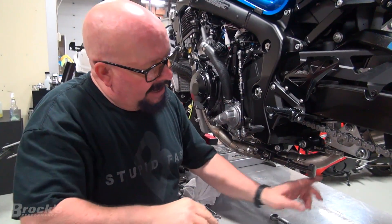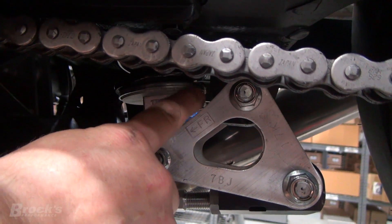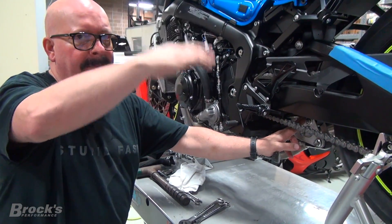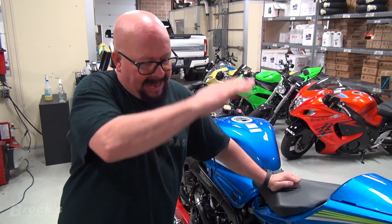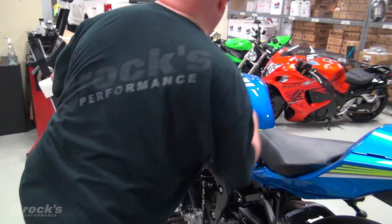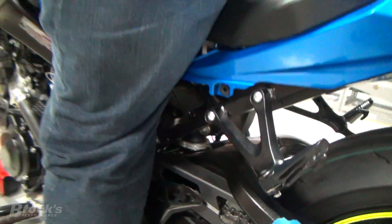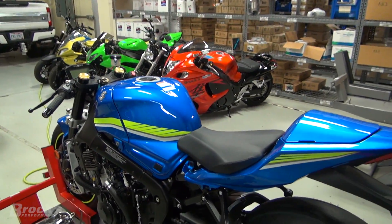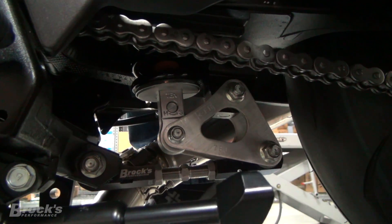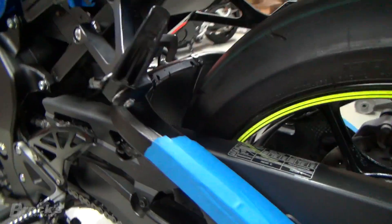You don't need to measure a bunch of stuff, just go ahead and adjust it. Keep in mind your travel - we've got the bike pretty low but we still have quite a bit of travel here. I'm going to lower this in a second and let you watch what the travel does when I'm bouncing up and down on the bike. Remember, your clearances are going to change depending on how the suspension is working. If I jump up and down on the bike, this is going to get closer. I'm coming down pretty hard and I still don't think we're going to run into that as far as the shock goes in the shock tunnel.